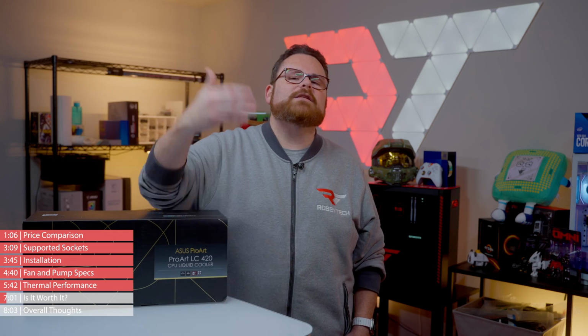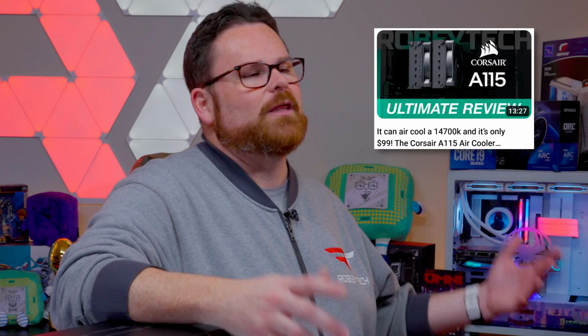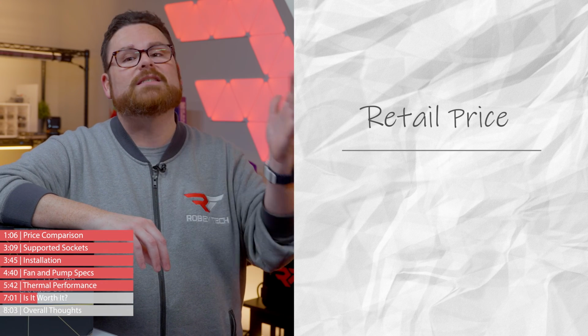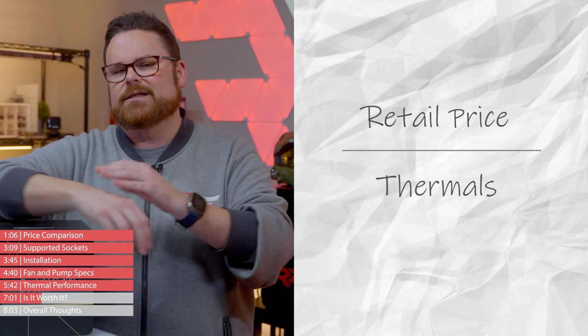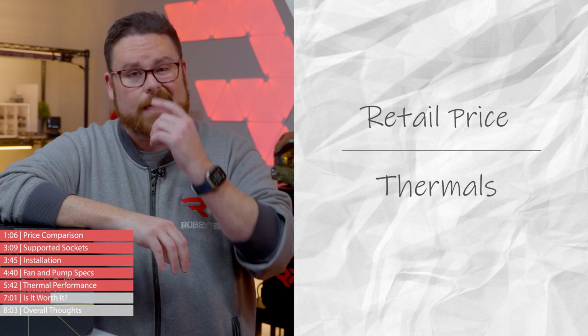So is it worth it? Well, now that we've seen how it performs, let's look at the relative value of the ProArt LC420. It's been a minute since we've done our last CPU cooler, unless this came out at the same time as the A115, and then you're seeing that already. But here's a reminder of how we do the math. We take the retail price and divide it by the difference of the CPU thermal max, which in this case is 100 degrees Celsius, and the temperature under full CPU load, which in this case is 86.